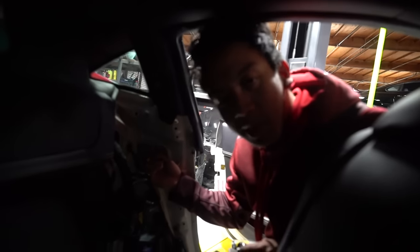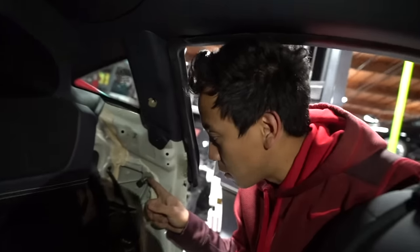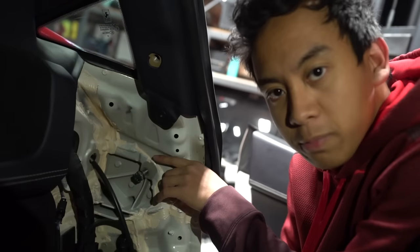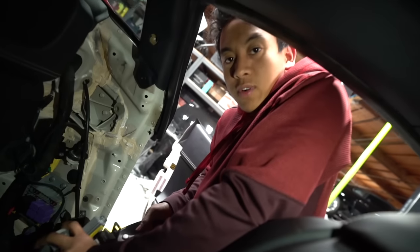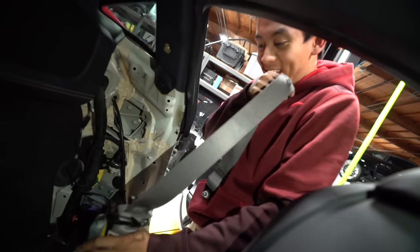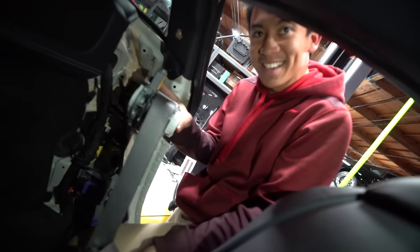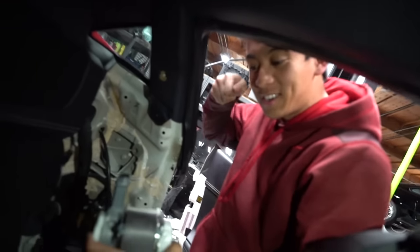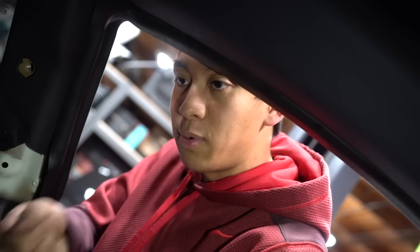The last part of today's build is putting the seatbelt back in. When the seatbelts are in, the interior is done and it can be driven safely. There's a bolt here and you see this notch — there's a respective piece that goes into that notch and it just pops in, then you put in the screw. What I learned from doing my 240: you have to pull on it really hard and it might disengage the lock because there's slack. You pull really hard to reduce the slack, and then it comes out. About four hours have passed.